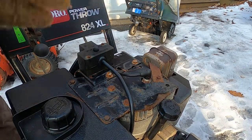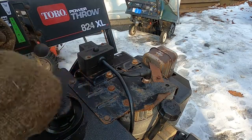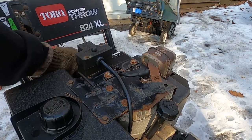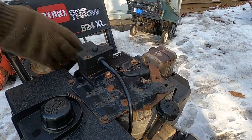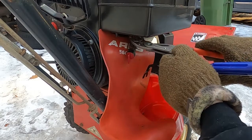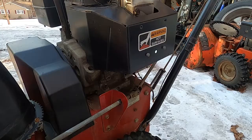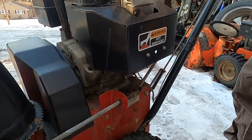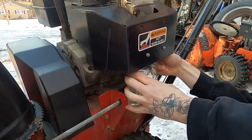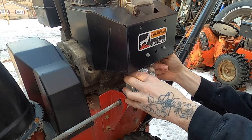It lit on the fuel we put in there, but even though it has fuel in the tank, it doesn't actually smell that bad. It's not great either. Let's make sure it can start again. She's not even trying to start. That fuel doesn't look that bad. Since this is an 80s unit it should have a drain on the carb — yep, it does. Let's get some fuel out of there, and that's going to tell us quite a bit about the health of the carb. We also need the carb empty so we can get the Mechanic in a Bottle in there.